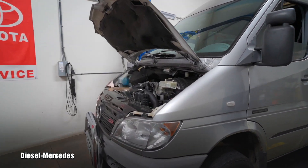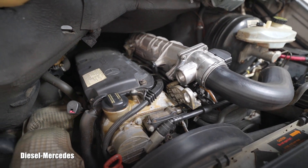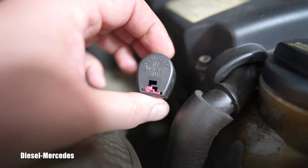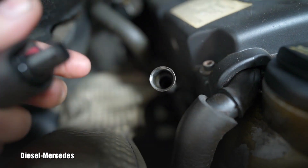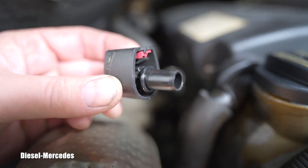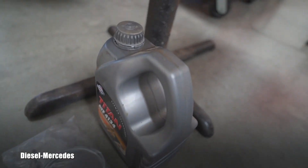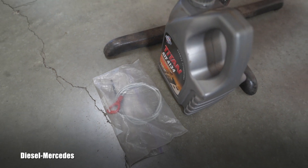We'll finally look underneath the hood at the beautiful turbo diesel five-cylinder engine. This one is a 2.7-liter, and you have access to the transmission from here. This will be the engine oil dipstick, and here is the cap which is plugging the transmission tube. There is no dipstick — if you are new to this and you remove this plug, you just find a hole and no dipstick. Don't be alarmed, that's normal. Using this you can check the quality and quantity of the fluid.